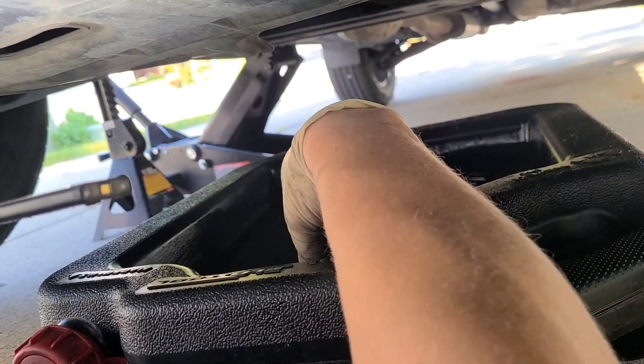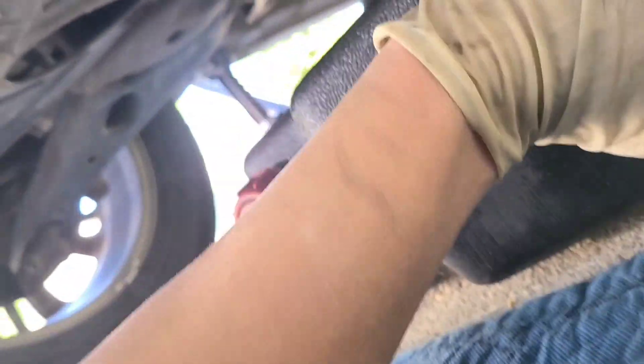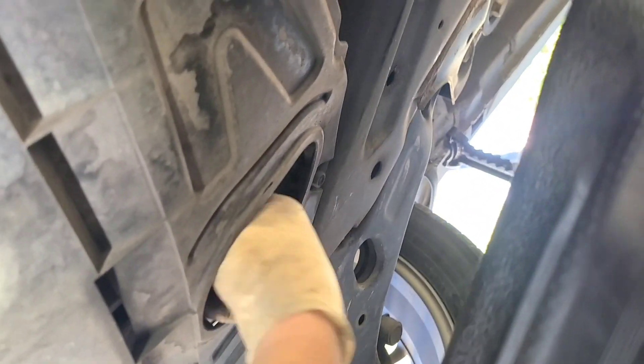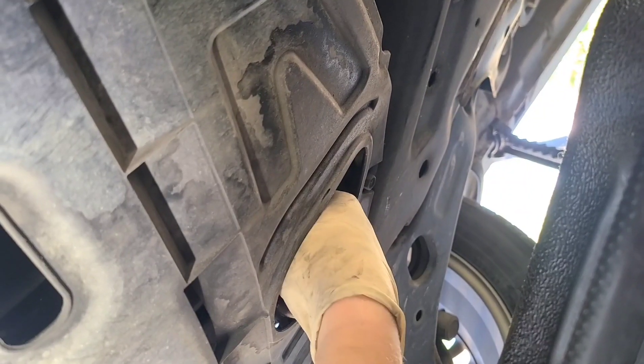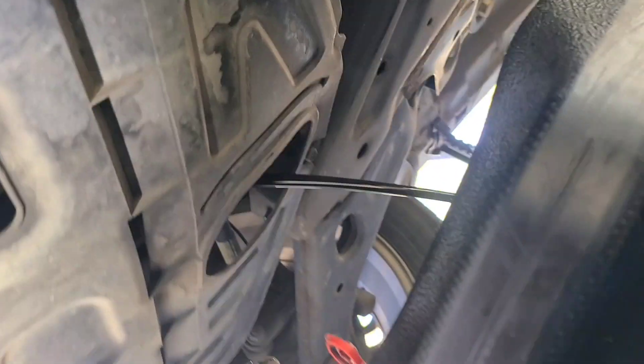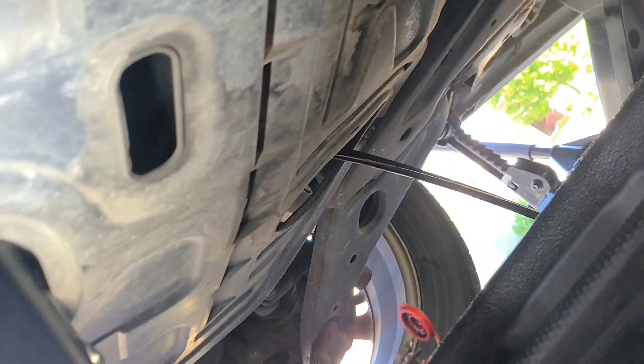Sometimes there's an access panel right here, and if you go back a little further there's another access panel — that's where your oil pan bolt is. Break that free; make sure your wrench is righty tighty, lefty loosey. Don't drain the oil if you can't get the filter free, so make sure that's loose first. I got mine loose, so let's get this bolt out and drain her.